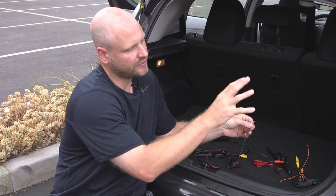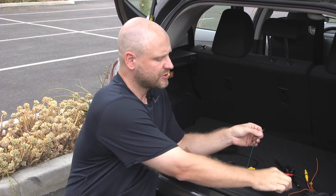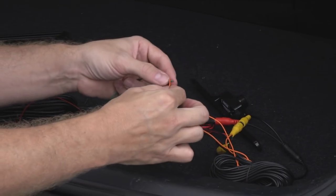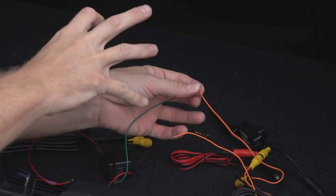This trigger wire is going to connect to our tail light — we showed you that last week. We showed you in the previous step that we can use this orange wire connected to the tail light, and on the opposite side we would make this connection, as this would bring that 12-volt signal to the front of the vehicle.